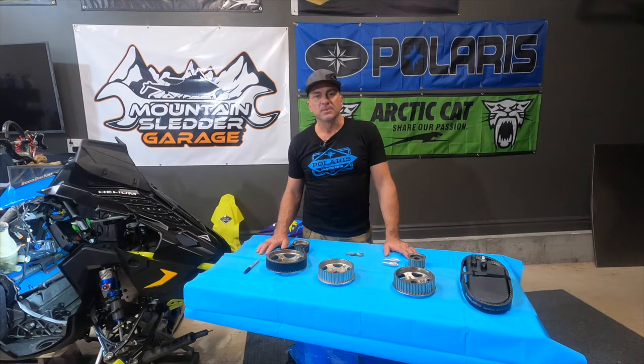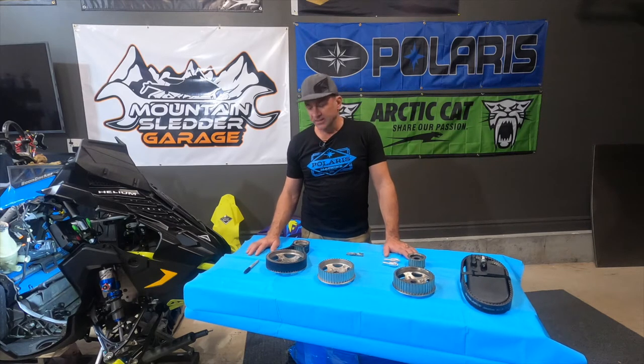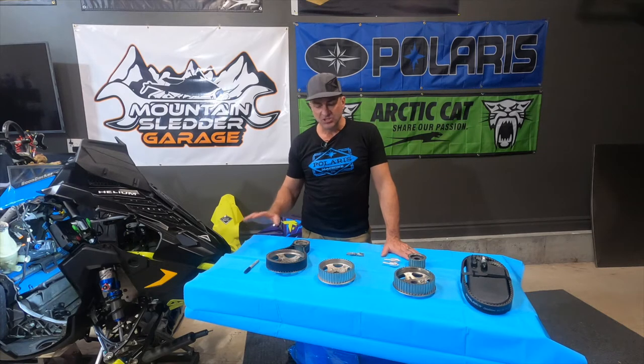First one: I saw a lot on social media last year of people asking about their belt drive on their Polaris — how to put a new belt on it, how often to put a new belt on it. As far as how often goes, in the owner's manual it says the quick drive belt is good for about 2,000 miles before you need to change it.